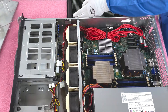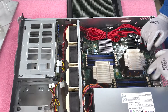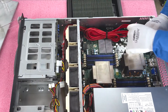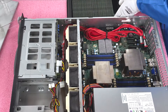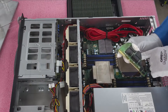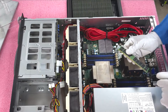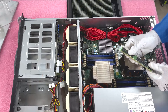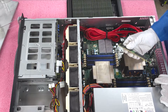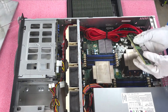Before installing, make sure all your tabs are open — it makes things much easier and prevents fumbling when seating DIMMs. Also, notice the notch in the leads — this is called a key. While it looks centered, it is not perfectly centered, so when installing into the DIMM slot it must be aligned properly. If you have it facing the wrong way, you can damage the module or even the DIMM slot itself, potentially throwing off the whole channel and requiring a motherboard replacement.